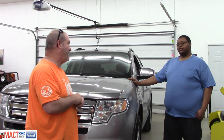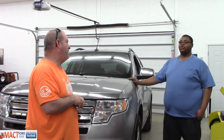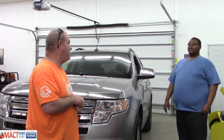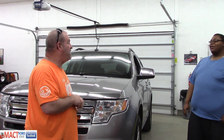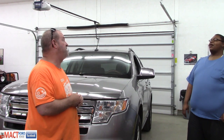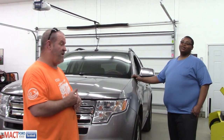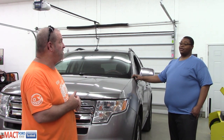Did you notice the shudder? No shudder, slamming in the gears. So you didn't notice the shudder? No. There's no shudder in it. What? I felt absolutely zero shudder. No shudder? Maybe because the spark plugs were changed. You probably had misfires. Oh. So your biggest problem now is your transmission. I felt absolutely no shudders.